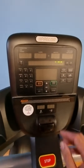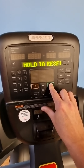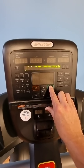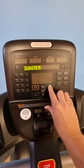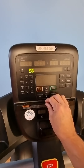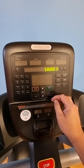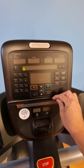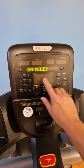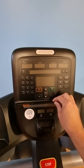If you've done a basic maintenance service, come up here into this setting and press and hold the quick start button, just keep holding it until the words scroll off to the left. When they finish scrolling off to the left, it's reset — you can let go. It's now reset to a thousand miles and will start counting down to zero, then the active status light at the front will start flashing on all treadmills and EFXs when it gets down past the thousand miles.